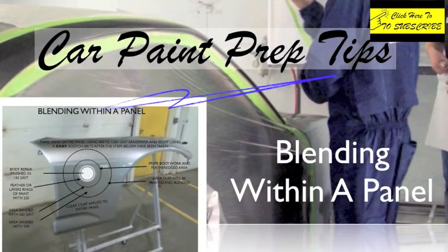Okay, now we're going to talk about blending within a panel. The same steps are going to be followed for the priming and blocking. We've got our 150 grit, and where we DA and feather edge, and where we prime, we're going to hit some 320, and then go out with 500. The area is going to be painted. The outside circle there is the area that we're going to spray paint, and that's what's going to be sanded with the 500, or 400 to 600, depending on your preference.